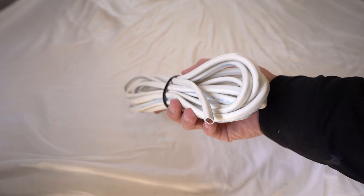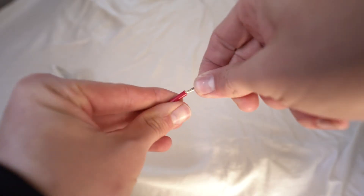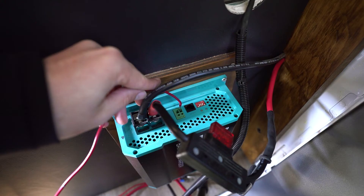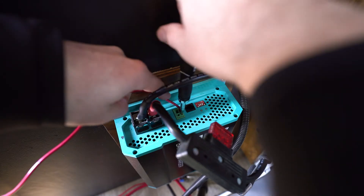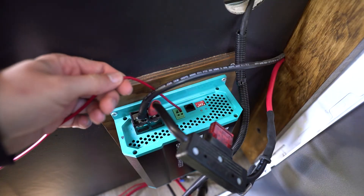To get this line set up you're going to need 16 or 18 gauge cable. Strip back the insulation so the bare copper is exposed and get a precision screwdriver with a flathead on it. Loosen the built-in screw, put the raw copper into the opening on the unit, and tighten the screw down. That'll keep the D positive wire connected to your Renogy DC to DC charger.